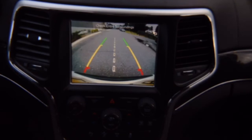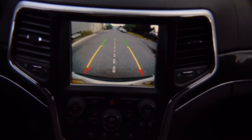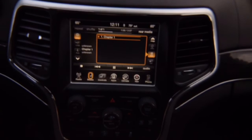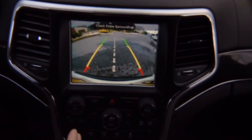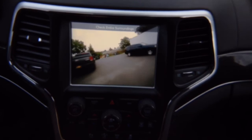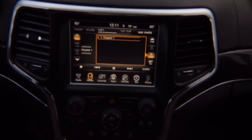It's important to understand: if you're driving really slowly, the front camera stays on — it only shuts off after 10 miles per hour. In reverse you get the rear camera; in drive you get the front camera for slow parking, then it turns off at speed. If you're not installing one of those cameras, the images will simply not switch over and the system continues to work normally.